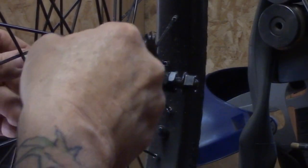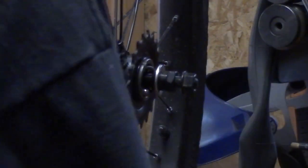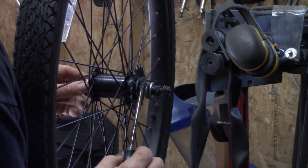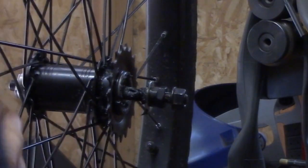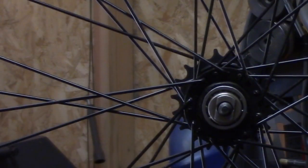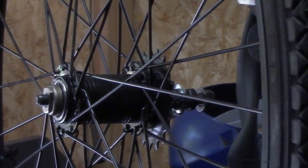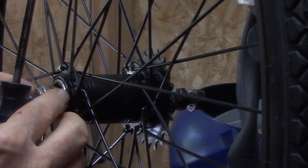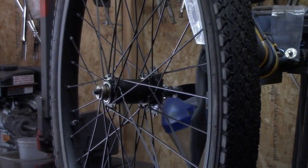There was junk on the other side, so now I'm screwing the sprocket back on, remembering to hold the anchor cone on the other side in place. Now I'm putting some grease on the smaller bearing on the outside. Now we're going to carefully pull the anchor cone out but keep it aligned exactly like it was, because there are two tabs on the clutch cone on the inside that the anchor cone goes into. I'm pulling it straight out just enough where I can get the bearings out - I'll grab my pick and pull the bearing out just enough to smear some grease on it.